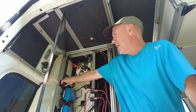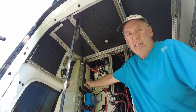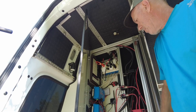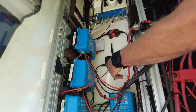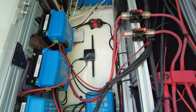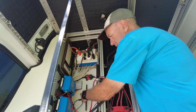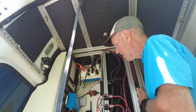All our 12-volt lights and fans come through here — they are individually fused, like your car or RV would have. So if something happened to the fan, it would pop this fuse and we'd just change it. Some other items in here include a travel router, which handles our internet. We have Visible Wireless, which is from Verizon. They limit you to one hotspot device, so if you tether it you can have unlimited. I tether it through the travel router, we connect into the travel router, and it works great. We'll do a video on our phone service and all the tips and tricks on how we get internet service.